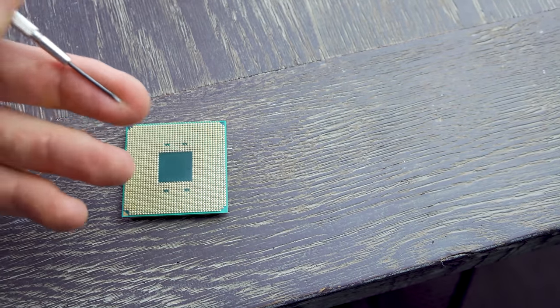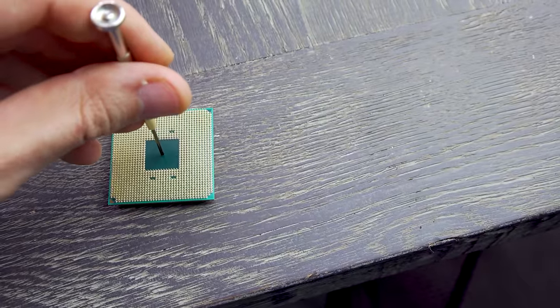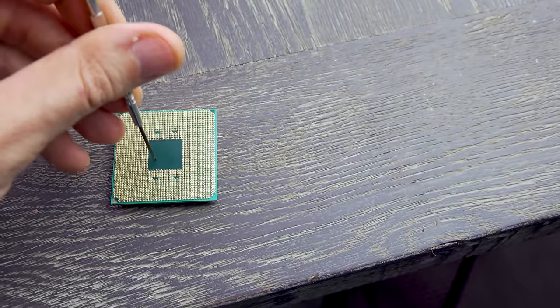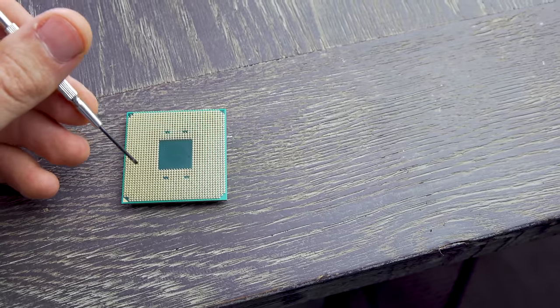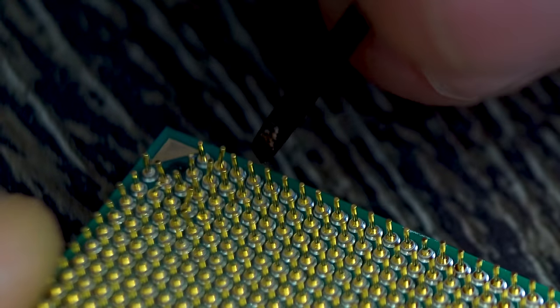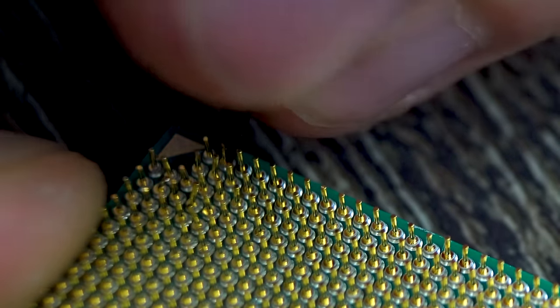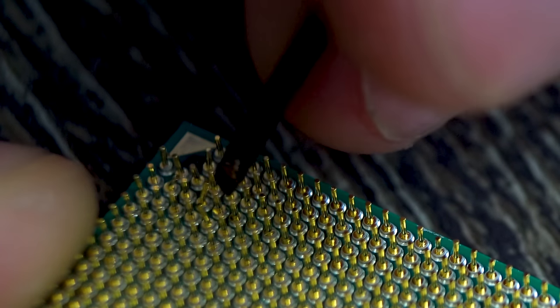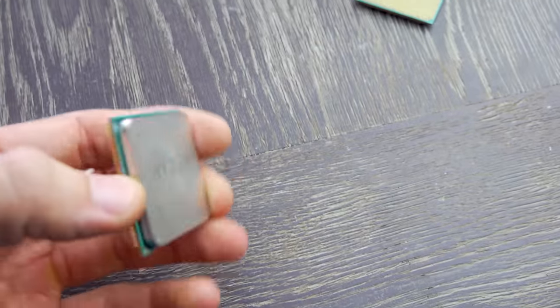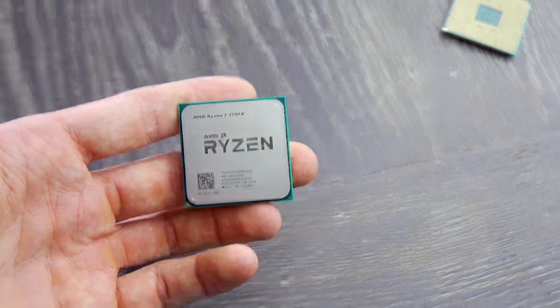And we've also got the actual edge on the screwdriver tip to slot in between two pins to create a wedge break, where, if one pin's bent back long enough, you may end up bending the pin before it back a little bit, but at the same time, we're still going to salvage that, bend it back, and then we can bend the one behind it back to normal. But anyway, let's first put this to the test and see if it works. Otherwise, it'll be all for nothing.